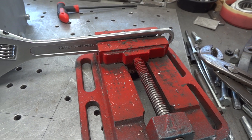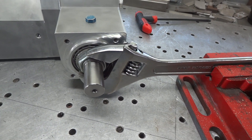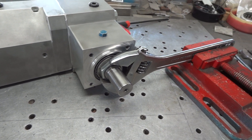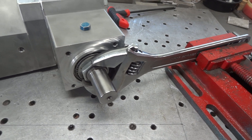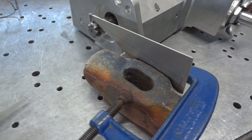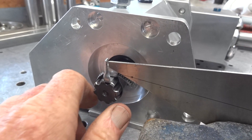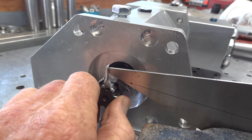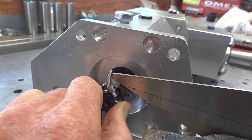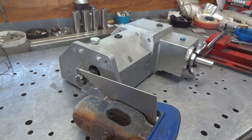Just a little aside here. This Heath Robinson setup is me checking the backlash on the gearbox now that we have the right shim in between the two cases. That pile of stuff is holding the output shaft in place, and this pile of stuff is set up to measure the backlash between the end of that fixed piece and the little tab poking off the input shaft. It measures 0.45mm, which is bang on the bottom limit. So I'm going to put that together for keeps now.